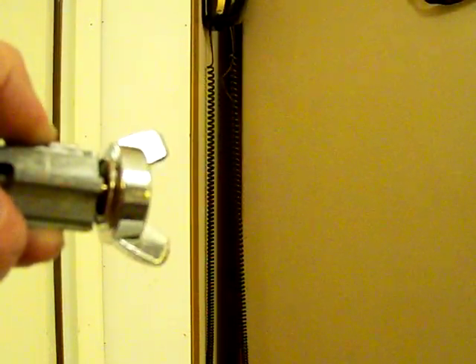I'm going to take a little screwdriver and reform the edges. As you can see, it's together — it doesn't turn. Now I'll hold it up and slide the correct key in and you'll see that it spins. Then I'll get a key we know doesn't fit, set it in, and you'll see that it doesn't work. So there you have it — a Ford lock cylinder that we have repinned, or you might say re-keyed. Thank you for watching. I bear no responsibility for legal purposes — this is a hard issue anyway. Thank you for watching.